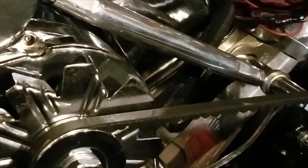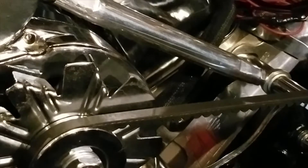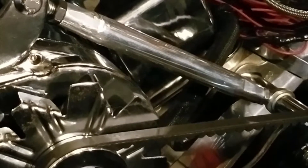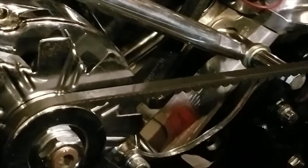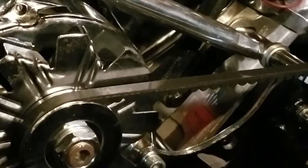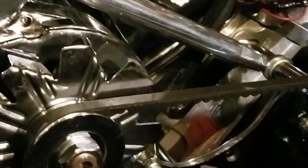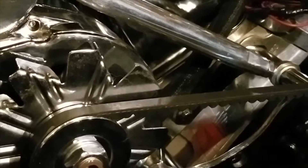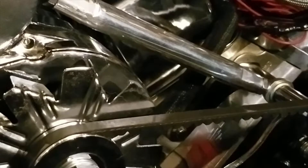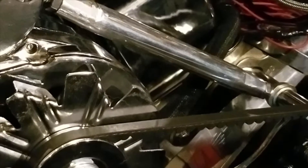The aftermarket industry kind of goes with that, but if you have a short water pump and have an issue putting your alternator lower down on the driver's side or up top on the driver's side, they make tons of brackets for that. But this is a short water pump and I had to put my alternator on the passenger side. They do make a handful of brackets to do this — the one I thought would work was about $180, which I thought was kind of pricey, so I figured out a way to do my own.